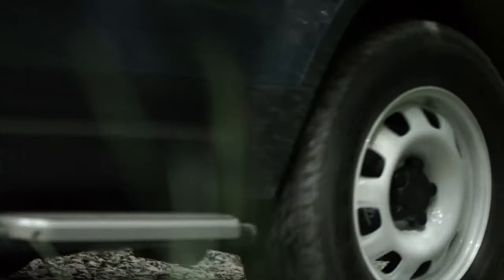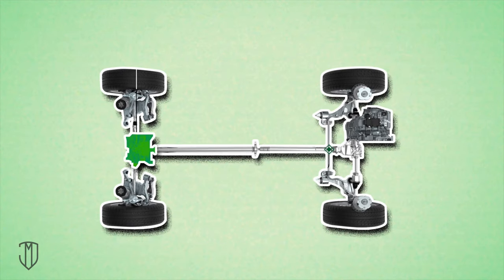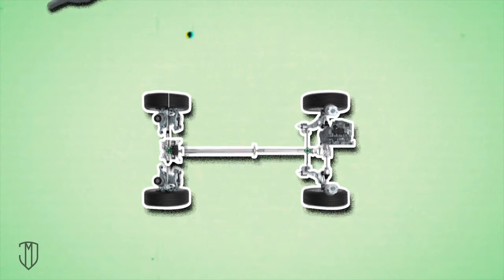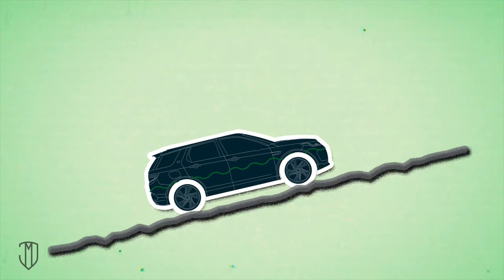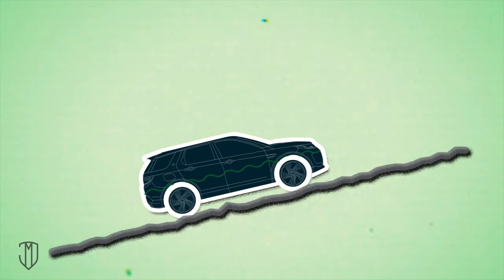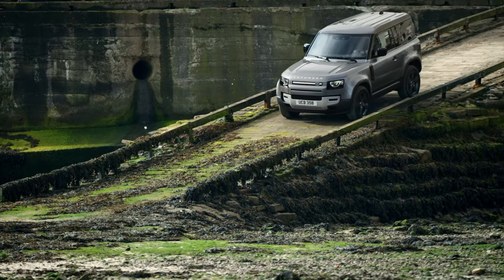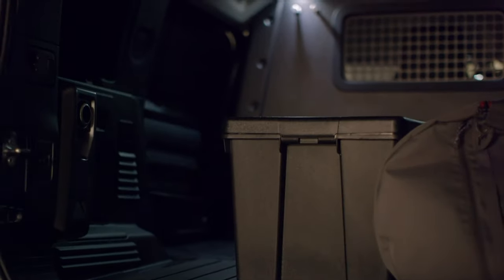Automatic lockers lock and unlock automatically without driver input, which is very convenient. The center differential lock performs a similar function, but ensures equal torque distribution between the front and rear axles rather than between wheels on one axle. For example, when going up a steep incline, the front wheels begin to slip because most of the car's weight shifts to the rear axle. In this case, the center differential lock automatically engages and prevents torque from escaping to the front axle. The new Defender is equipped with Terrain Response System 2, whose intelligent electronics choose the best transmission mode depending on road conditions — a feature that should help make the Defender more popular on American highways.